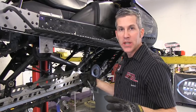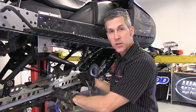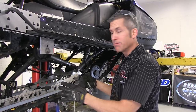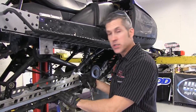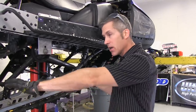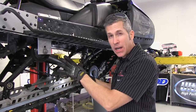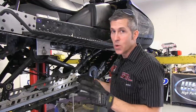You might ask why we're putting scratchers on a sled, and there are a couple of different reasons, but the main reason is for slider life. If you get on some hard-packed trail — maybe you have to do a little bit of road riding to get to a trail — you're going to start to wear down your sliders if you have no lubrication. So you'll grind into the ice, pull that up, and spray it on top of your sliders inside your track. It's going to help you out. It might add a little bit of additional cooling up into your cooler, but honestly it won't add a whole lot.